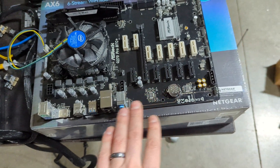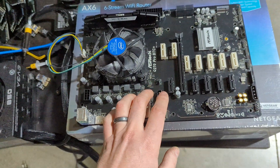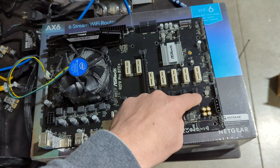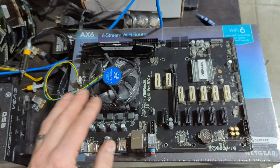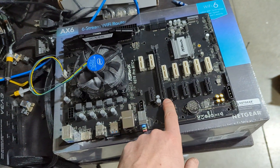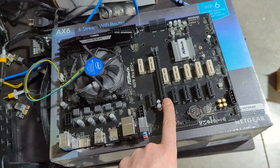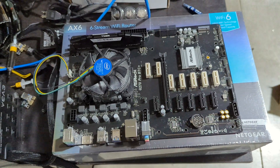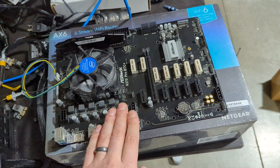In terms of what this motherboard can handle — this motherboard can handle all 13 GPUs. We already tested it out. You can see here it's got 1, 2, 3, 4, 5, 6, 7, 8, 9, 10, 11, 12, 13. It's got 13, and we ran them all on a 3080 rig. They all ran just fine. It's not one of those situations where all of them work except the 16x slot — actually all of them do work, including the 16x. Some other mining boards out there have the 16x lane that does not want to work; you plug it in and it doesn't want to boot up. This motherboard has no problems, so you can run 13 GPUs.